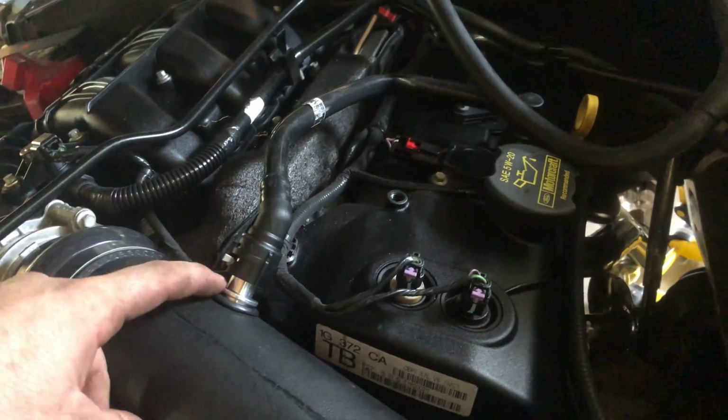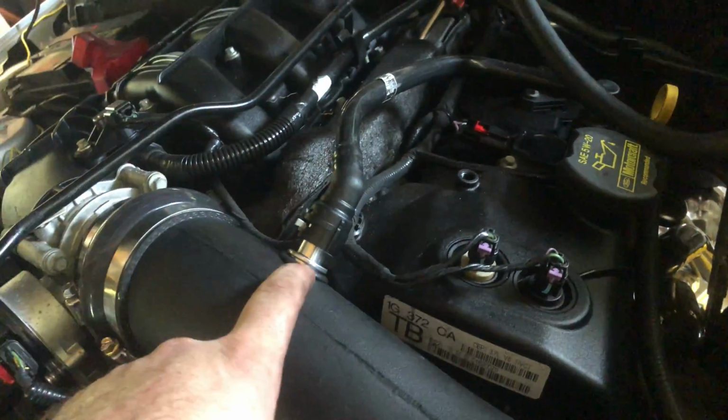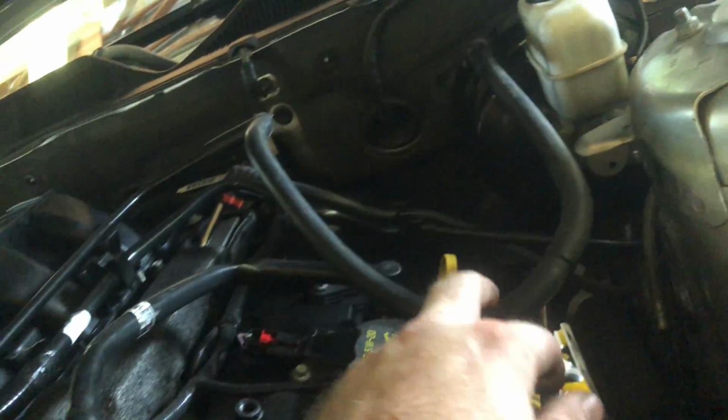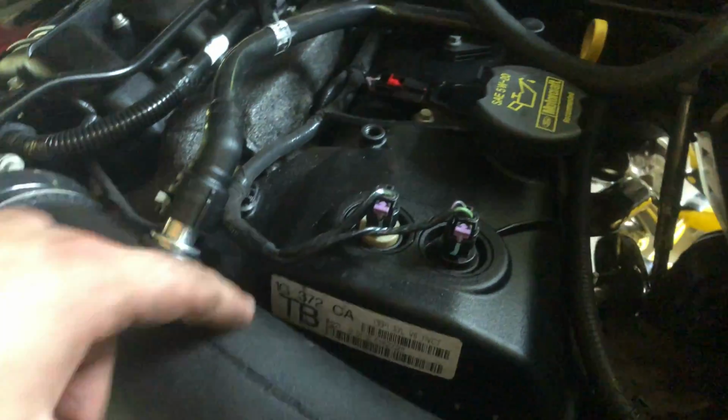It's gonna be interesting. It's gonna be really loud. So let's see it. So I had to change a few more things than what I showed you guys. I'll show you though, it's real easy. Mainly this hole was too small, so I couldn't use the nipple from the air raid, so I drilled the hole up bigger, swapped the gasket and the nipple over so that could connect. It doesn't have the secondary line here. For whatever reason, it's not on there.